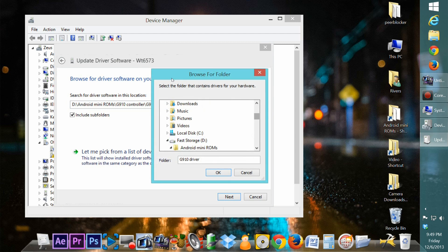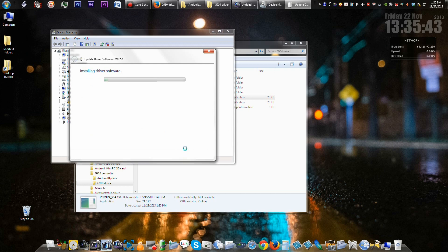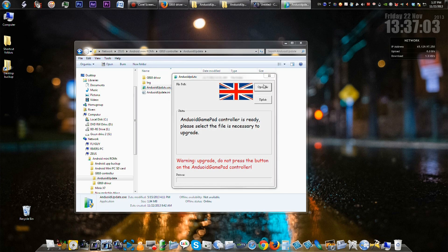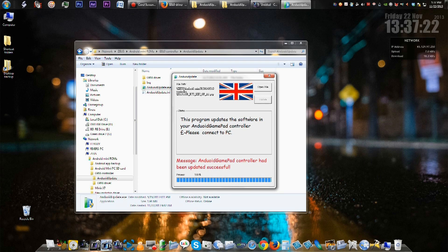You'll choose Update Driver and then specify the location where you downloaded the drivers to. Now these are unsigned drivers, so if you're using Windows 8, you need to go into Unsigned Driver mode — I'll put a link to how to do that in the description below, it's fairly complicated. Here I'm installing it in Windows 7, and you can see you just get this red warning box saying the driver's unsigned — just go ahead and accept that and it will install the rest of the way. Once you have the USB driver installed, open up the Update Android.exe, point it to the location of the image file in the img folder, and choose Update. If everything works okay, you'll see the status bar go. If it stops at 1%, your USB driver is not installed correctly and you've got to go back and fix that.